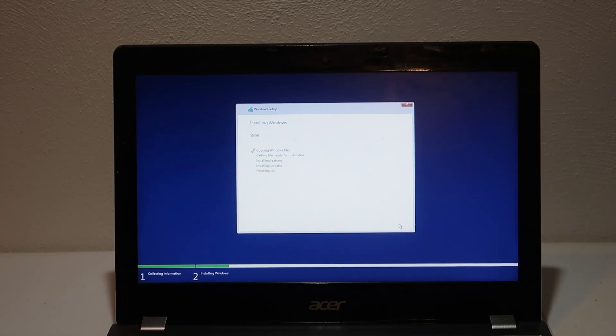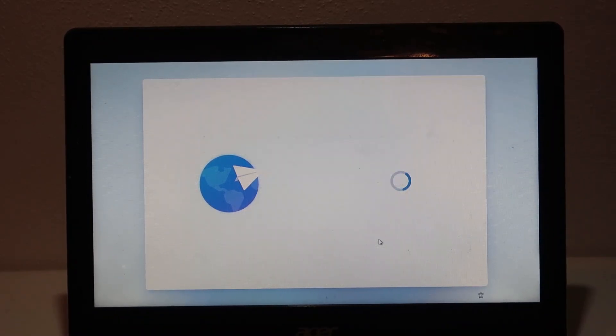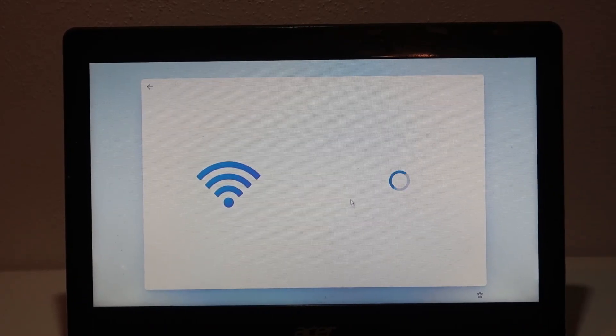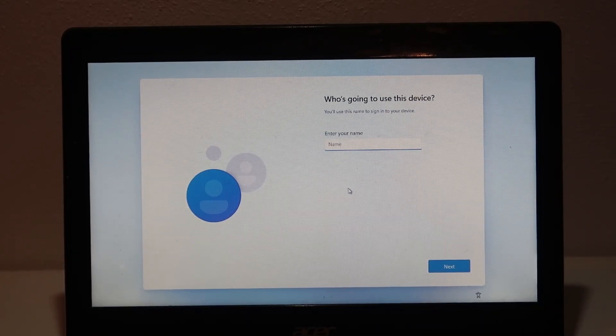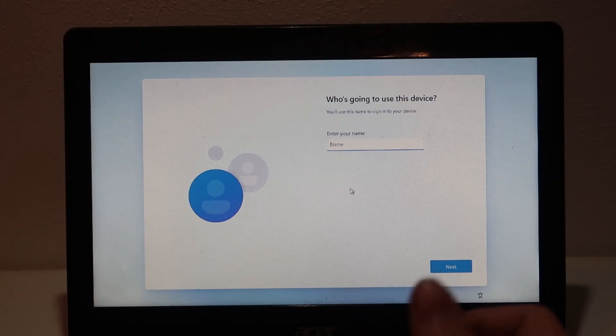This could take a while depending on how fast or how old your system is, so go ahead and let this run until you see Windows setup. And here we are - we are now in the Windows 11 setup on our Chromebook. We've done it. All that's left to do is set up Windows like we would on a normal computer. My network would not connect, so I'll try that later. However, once we get into the desktop, all we have to do is install two drivers: the Chromebook keyboard remapping utility and the touchpad drivers. Once we do that, the graphics driver will download automatically and we should be good.